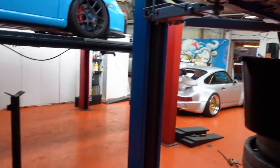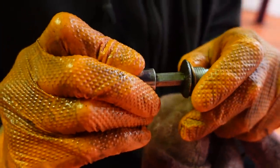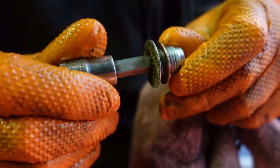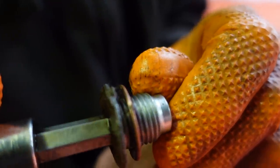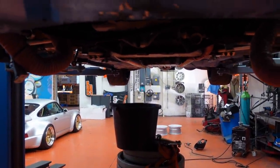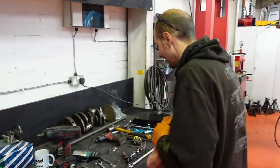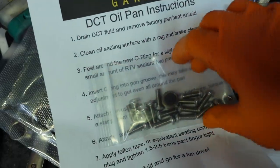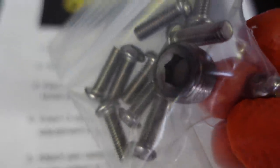We were pretty close to having a problem. Check this out — the old drain plug was so damaged I had to brutally hammer an Allen key into it. Look how thin it is now — ground down to almost as thin as the copper washer. It's put a nice taper on it to match the floor. Gareth must be doing his testing on roads with a hump in the middle. The titanium skid plate did its job — it didn't dig in. The new oil pan comes with a much nicer Allen hex drain plug, plus stainless mounting hardware and the O-ring you need.